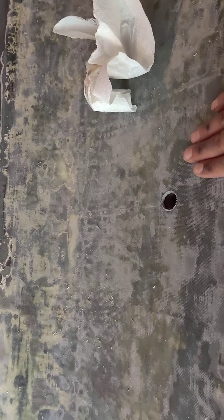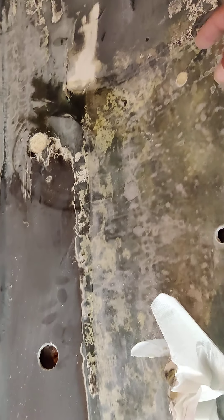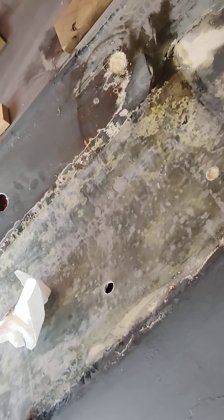Then we'll go over the top of this with another layer of mat — probably, and if I can talk them into a flexible epoxy, something like G-Flex, to lay the mat with — which, if there is still some flex, it shouldn't crack, because G-Flex is a flexible epoxy where most epoxies are extremely hard. I'm going to wait and let these cure. My next pour will probably be here, because it should be 20 minutes between the two adhering to each other. So if my next pour is up here, this one will be close to 20 minutes by the time I'm done. Then I'll do a center pour, either in these holes or those, depending on how it fills. And that, I believe, is how — without completely replacing and cutting the boat apart — you can at least repair a foam job that was done wrong.